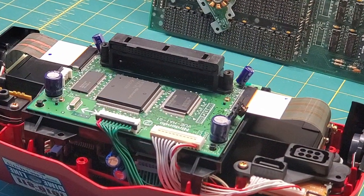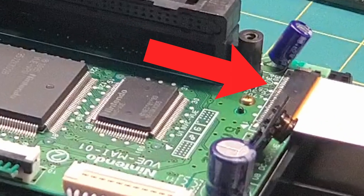If you notice annoying horizontal lines across one of your screens, you may think it's time to try again with the heat treatment. But actually, I found that these horizontal lines come from the other end of the ribbon cable. Closely inspect the leads of that upper cable — you may find that one of the leads has bent down. Straighten it out and gently reinsert it to fix the problem. You can also try gently jiggling the cable to get those lines to go away.